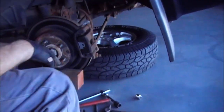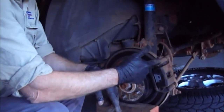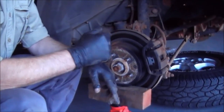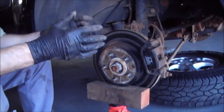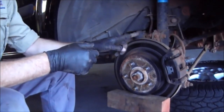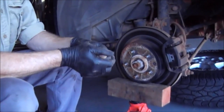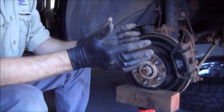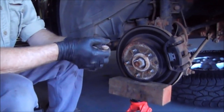That's it pretty much done. In that short time we've changed the brake pads. You might need to bleed the brakes after this — it's probably a good idea to give that a go anyway. Just out of interest, I've had a couple of people quoted $1,200 at dealerships to do all four wheels with brake pads and rotors. You're probably going to get good brake pads for around $150 for a full set, and rotors for a couple of hundred dollars as well — so it's a lot cheaper to do it yourself. Thanks for watching, bye.